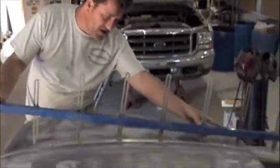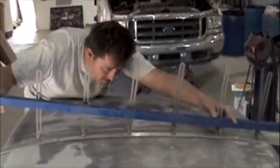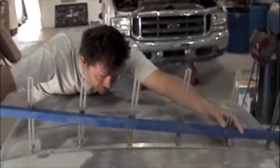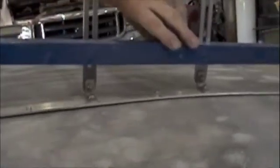I got out the gauge tool and put the gauge tool on this side. I got a real nice line to this. If we move the gauge tool over to the side that looks like it had damage, but I think this is a factory dip in it that was right here. If you see, we got a low area through here and a low area through this center area here. If we move this all the way across, you'll see that it's low and it comes back to smooth right here.